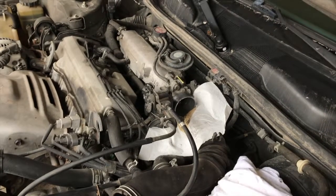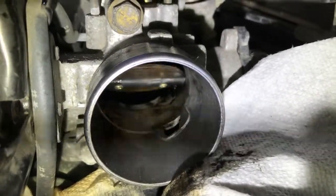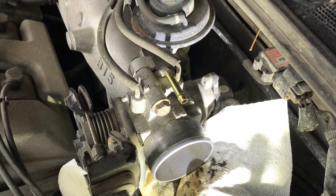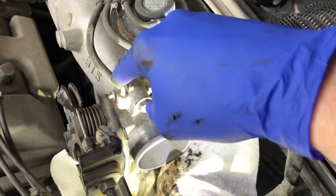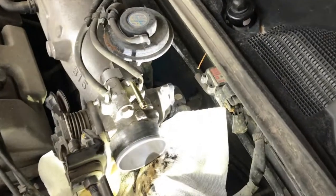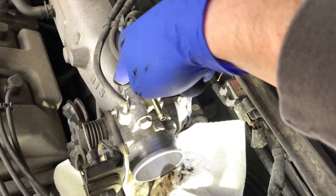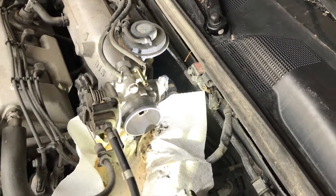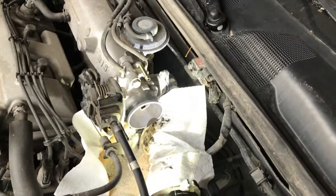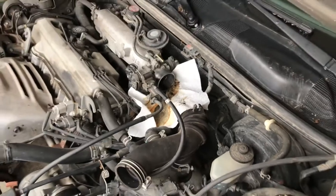For the most part I've got it pretty well cleaned up from what I can actually reach inside. You can still see a little bit of grime remaining. You don't even want to know what that shirt looked like — I will never wear it again. One more thing: if you want to continue cleaning further inside, you can remove the actual throttle body itself. However, take into consideration there is a rubber gasket between the throttle body and the intake. If you harm that during removal or reinstallation, it will degrade engine performance. I recommend having a replacement gasket from AutoZone handy just in case.